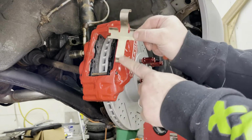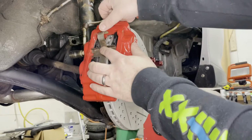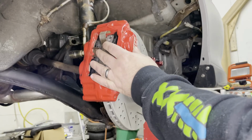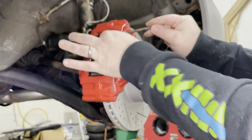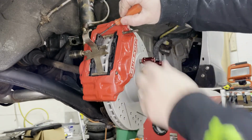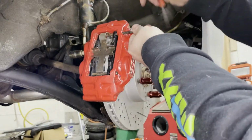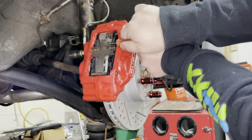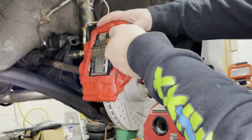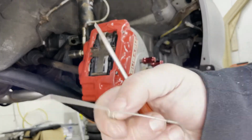If you look at it, it has this hook piece, so the hook kind of hooks on that one, and then you swing it up, and these pieces here apply pressure to the pad, and then this one will hook onto the top pin. So we will install the top pin. Again, got to line up the hole. You'll see that this one's in a little, so we've got to kind of help that out at the same time as hooking that guy on there. And through it went.